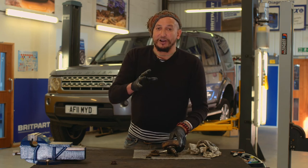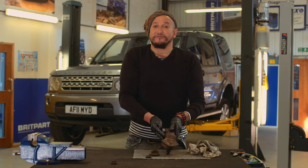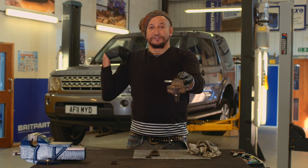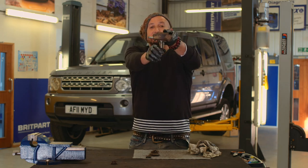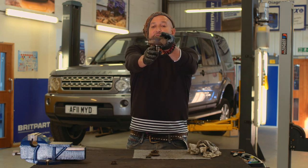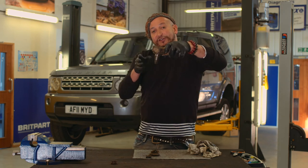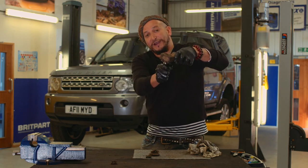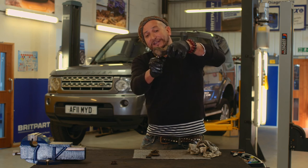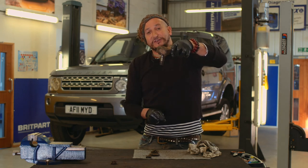That's exaggerated of course, but the front axle and rear axle would be going along in line, but one would be further out than the other. It's not a good thing - you get loads of tyre wear, it's dangerous, bad for the vehicle, bad for handling, and it's going to affect your ride an awful lot. This is how the A-frame is situated - this is towards the front of the vehicle. Imagine my shoulders are the outer edges of the A-frame, and this pin goes through the rear axle. If there's any movement here, it will allow lateral movement from side to side. Just a little bit here can amplify into an awful lot at one side or the other. And also, while the vehicle is trying to move away and the wheels are going around, it will allow the axle - which is attached directly and solidly to this pin - to tip forwards or backwards. That's what we want to avoid. That's why if this is worn, it needs to be replaced immediately.